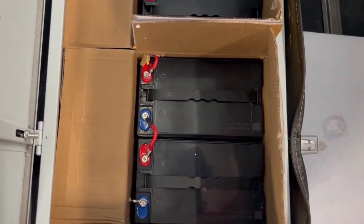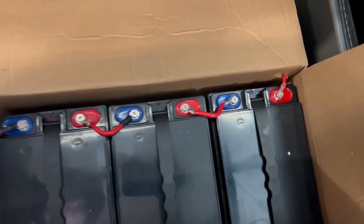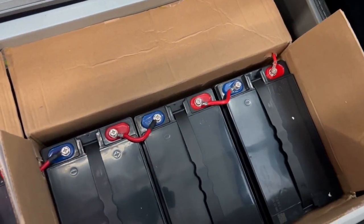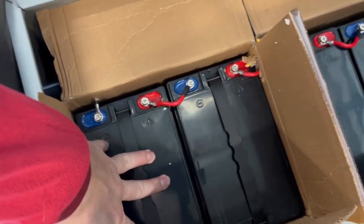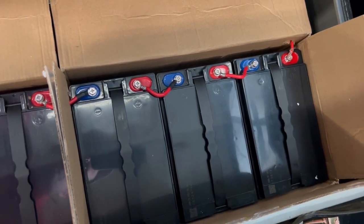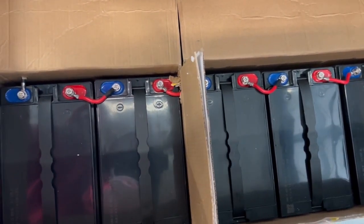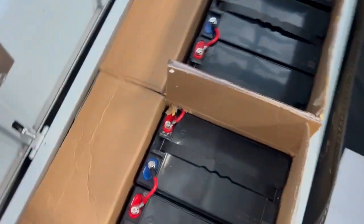What you have is five batteries — they're all 12-volt batteries, and they are in a sequence where we go positive to negative, negative to positive, all the way along. The two end batteries then go back to the controller where they're going to power the motor. The way they're set up, what tends to happen is that the battery on each end takes the brunt of the draining, because they're the ones next to where the draw is towards the motor.